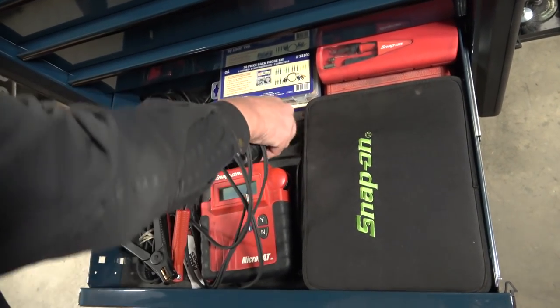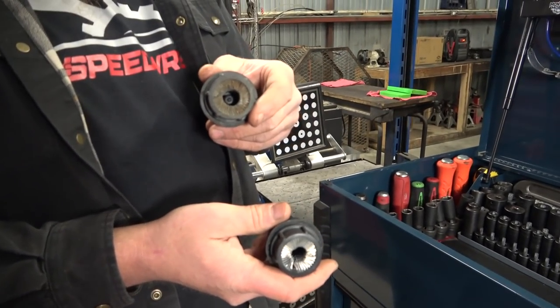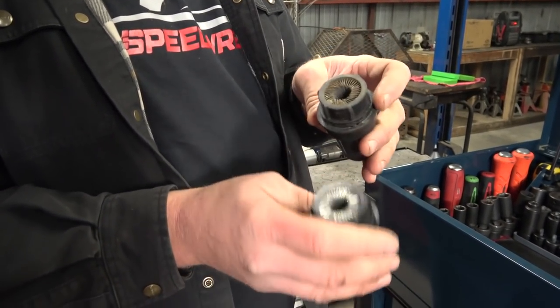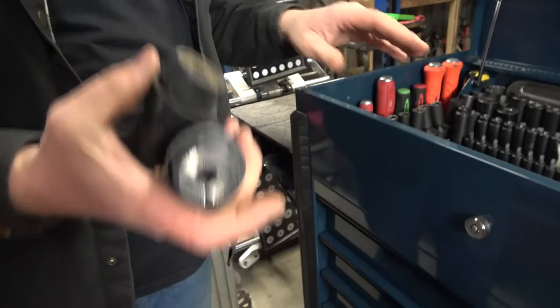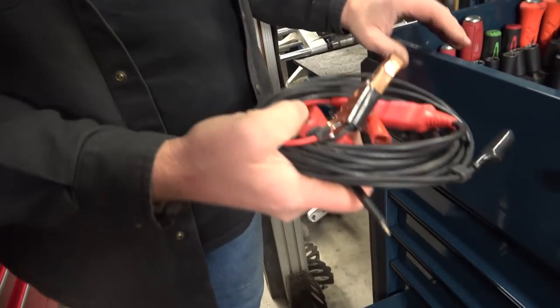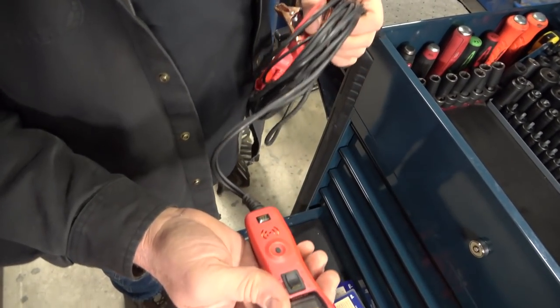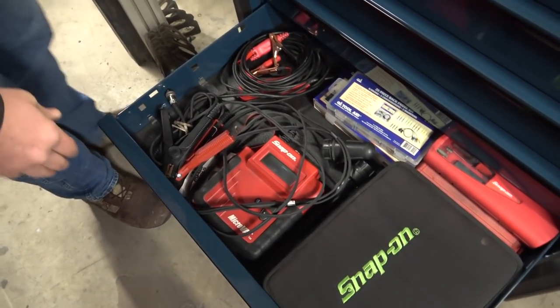I'm dorked out — I have a positive and a negative battery terminal cleaner. On a top-post battery, the positive and negative are two different sizes. This older, more worn one is positive; the newer, smaller one is negative and that's what I use for the negative side. My Power Probe 2 is right here. I have two of these and I'll never get anything better because I like the simple function — it checks for power and ground, you can apply power and ground, and with a little adapter I can go to a five-volt reference. I have no interest in the new power probe.